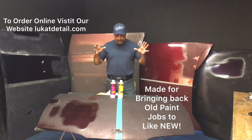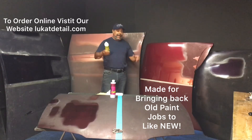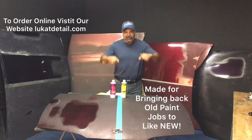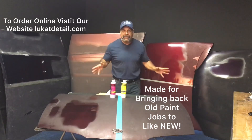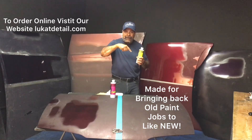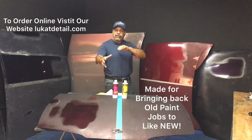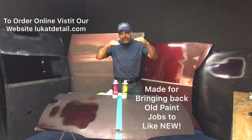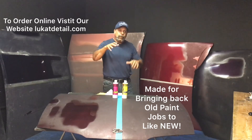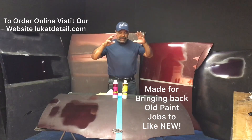Not all clear coats can be fixed. When a clear coat comes off, it's gone — it's not coming back. What you can do with this is bring back the color on the exposed color base coat and make it shiny, then lock it in and seal it. The remaining clear coat you can polish out. Because the clear coat and the base coat are both refracting light, they blend better and look better. When they're ugly, they're flat — they're not refracting, there's too much contrast and it makes it look worse.